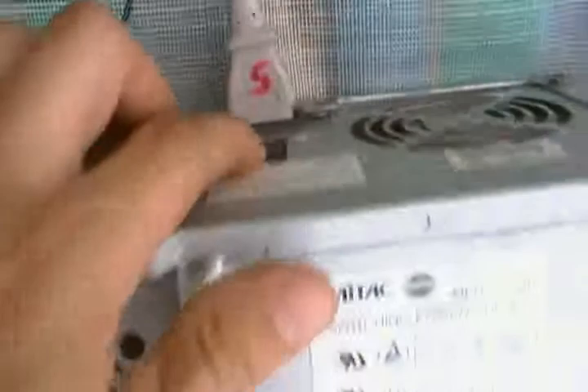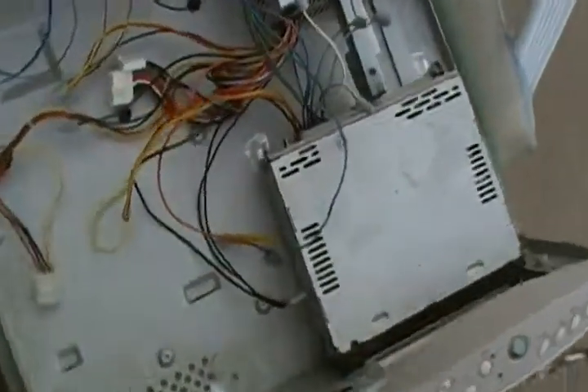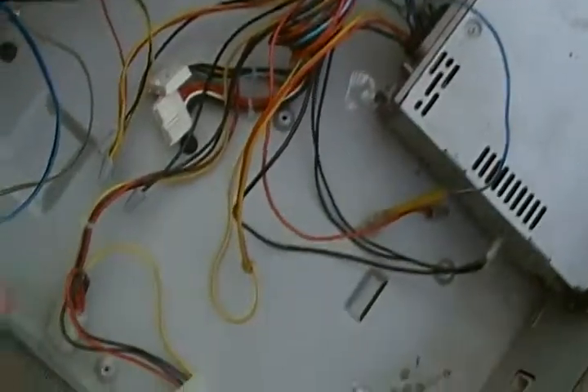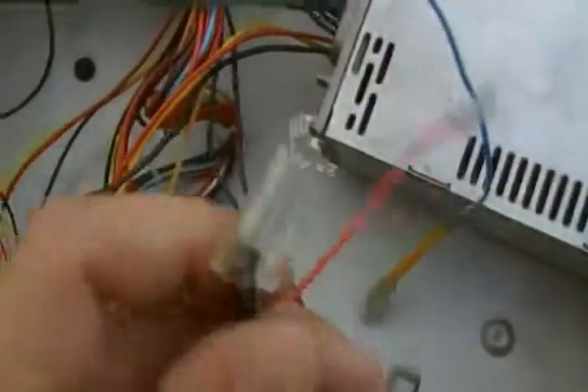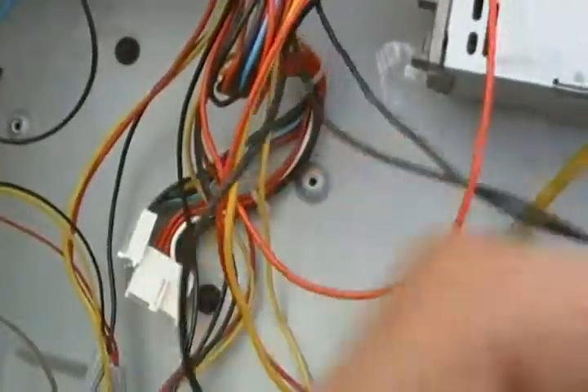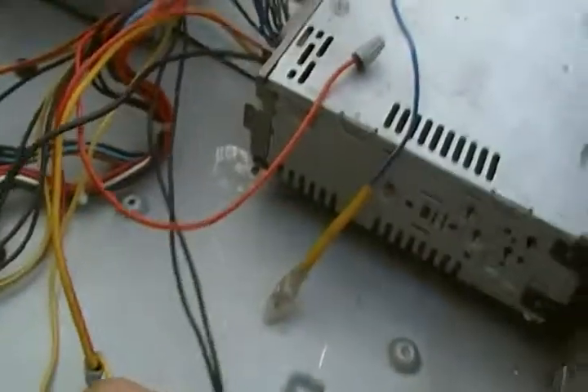I have a master switch back here, which means presets will not stay set — it will be as if I unplugged the battery every time, if it was plugged into a car. Your black grounds from the amp and your ground from the radio naturally attach here, and I'd recommend putting wire nuts on them and then taping them up.